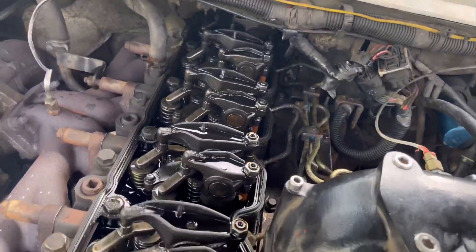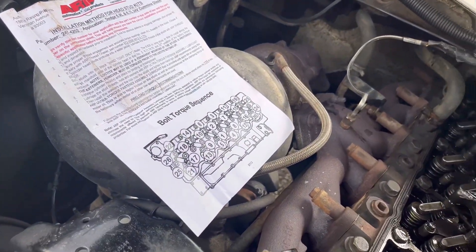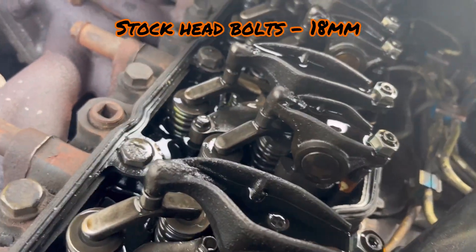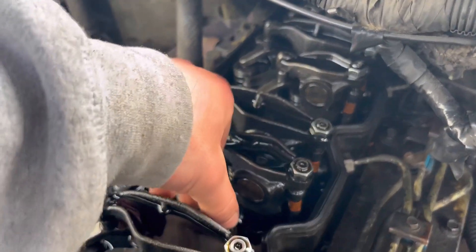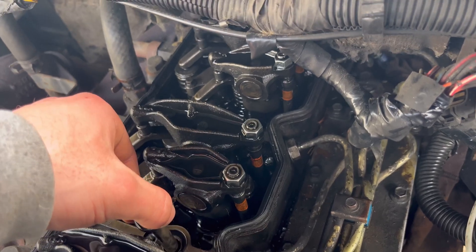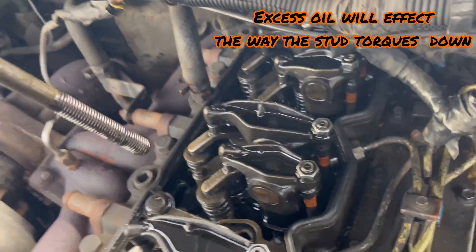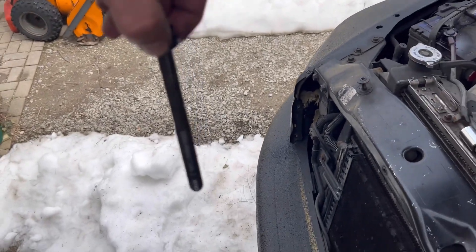Because we're doing it one at a time, you don't need to worry about the head gasket — they found this way works without ruining it. Use an 18mm socket; you'll probably want an extension. Try not to get any oil in the hole, as it'll ruin how the stud bolts down. That's the head bolt we're replacing with the head stud.